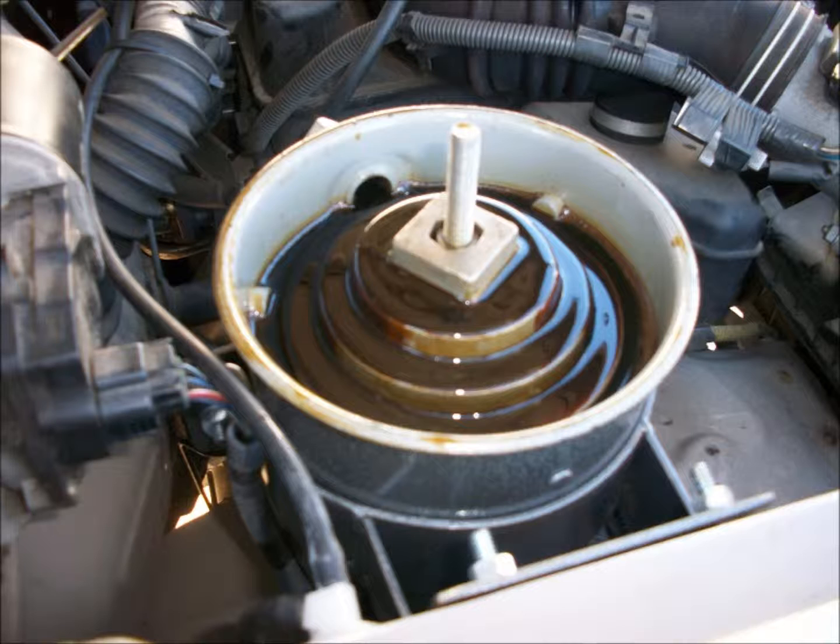Return the engine to idle. Reinstall the heated lid using a rag or a glove. Install the washer and wing nut provided — hand tight is fine. And that's it. The Everlast Refiner bypass oil filtration system is installed and the flow rate is established.